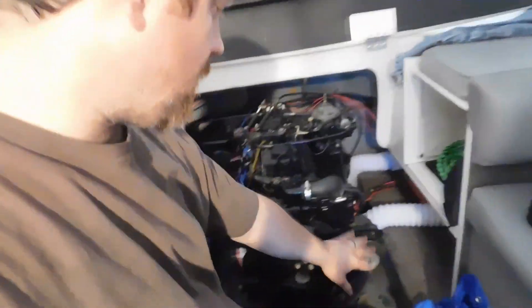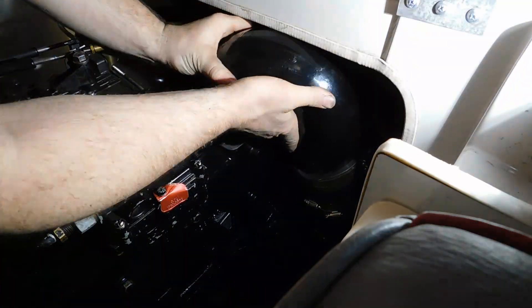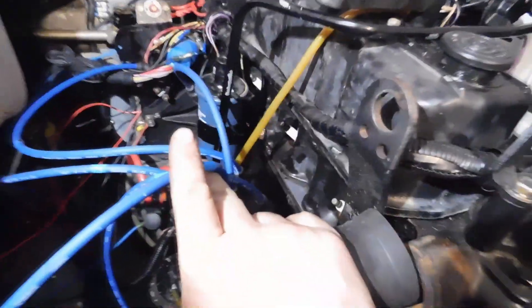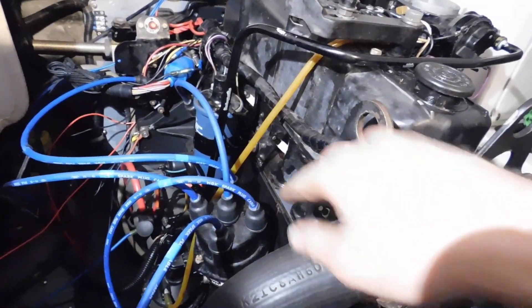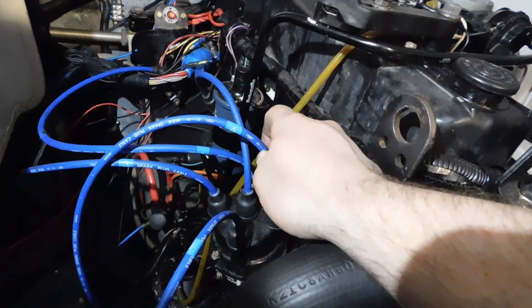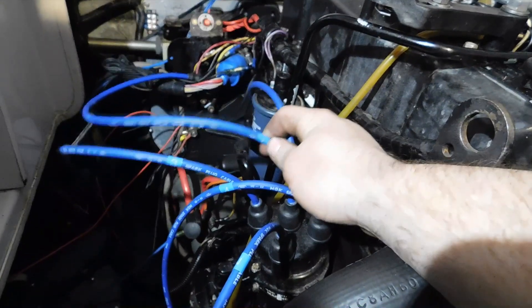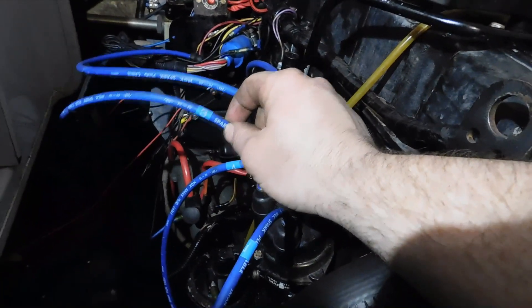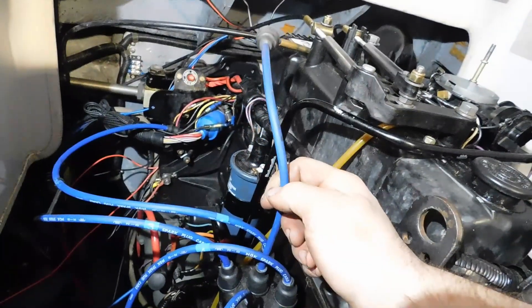It's day two. Since I last had the camera on, I threw on the valve cover, put the alternator back on, and tightened the belt. All that's left is hooking the exhaust back up, putting the spark plugs in, and showing the correct spark plug wire pattern. This plug wire goes to your first spark plug, this one to your second, this one to your fourth spark plug all the way in the back, and this one to your third spark plug. The one in the center goes to your coil.